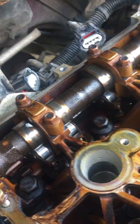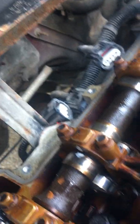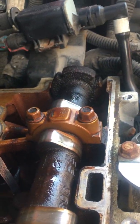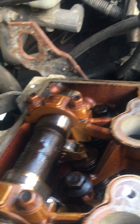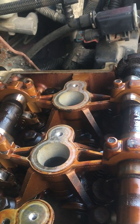As you can see — it's hard to see — but the lobes are actually on number 1, just past top dead center. You can see that the intake lobe has just passed. And what you'll notice is back here on cylinder number 4, both intake and exhaust lobes will be in this orientation — kind of facing each other — because those valves are pretty much totally closed.